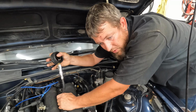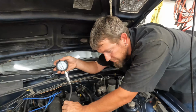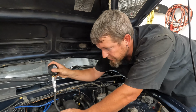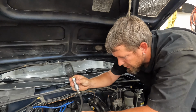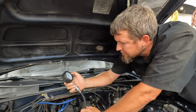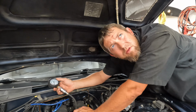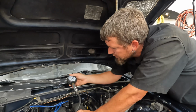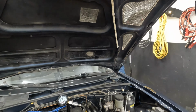Rule of thumb over the years, from what I've heard, is if all the cylinders are matching, you're in good shape. If you've got a cylinder that's not matching, then you have a problem, and a 10% difference is bad. Anyway, number three, I'm gonna test again. It was the one that was, what was it at, 150? I don't remember. 120. Was it down 120? Yeah, it was 120 here, right? Okay, so we're gonna try this again on that one.